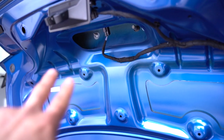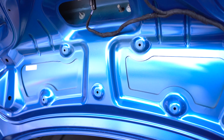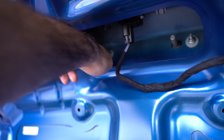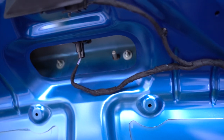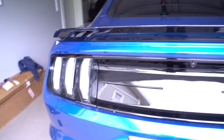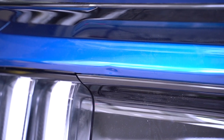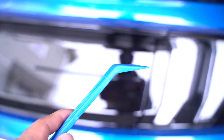And this is one of the reasons why I have not put back the deck lid liner — because I will see if I can get an appointment this week. I can feel the dent with my hand going through here, so hopefully they can get their tools in and fix it. So that was a real mistake — look at it, you can see from here it looks really bad. So whatever you do, don't use one of these kinked prying tools on the car, or at least while doing this type of work.